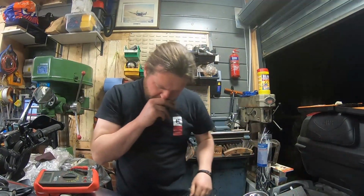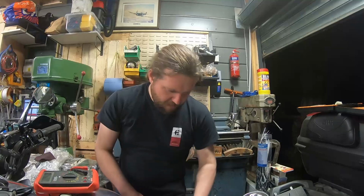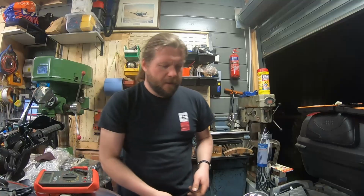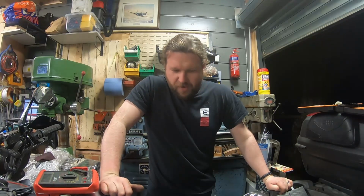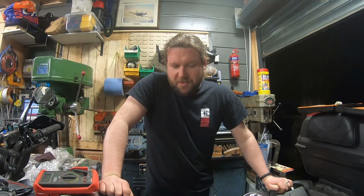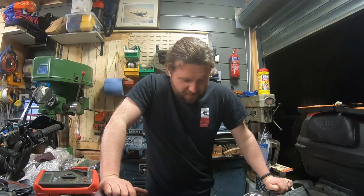Result. So it was the rectifier that was dodgy. I think that was a bit of a foregone conclusion anyway. But nice. So they get very hot. Interesting. I just did a bit of googling around to see what temperature a rectifier should get to, and the consensus seems to be anywhere between 60 to 100 odd degrees. That one gets straight up to 60 degrees and then sort of regulates, which seems good. After 5 minutes it was 60 degrees, after 10 minutes it was 61, so interestingly the same temperature as the exhausts. So just need to get it mounted now